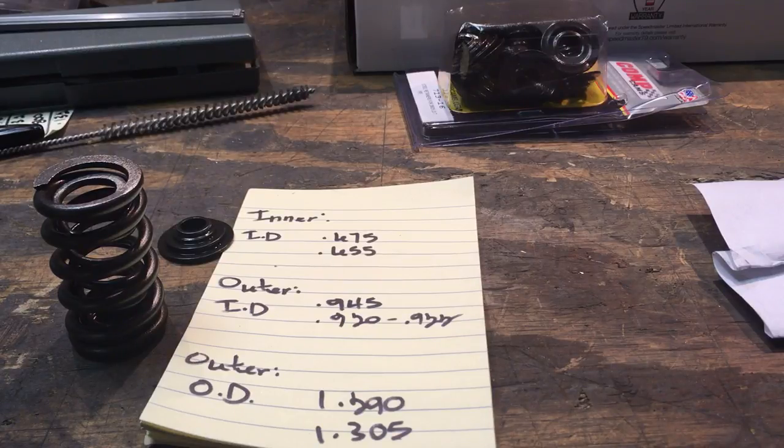But in this particular circumstance, I would at the very least have to use a die grinder or a stone or something to open up the inside diameters on all of these valve springs in order to use them with the appropriate retainer. When you purchase a set of valve springs from a manufacturer and they tell you inside diameter is 675, outer inside diameter is 945, outside diameter is 1290 — you should be able to bank on that, go to the store, get the right components to make those springs work. And that's just not the case.